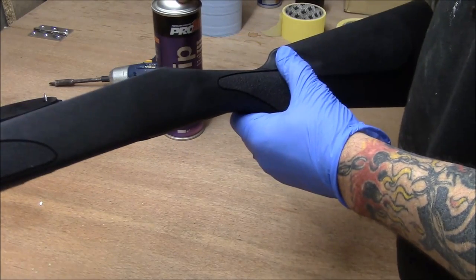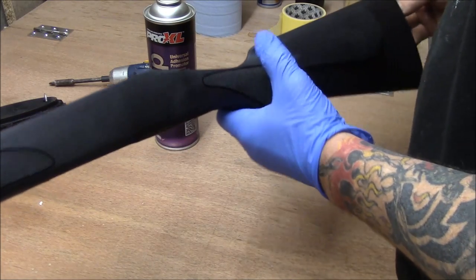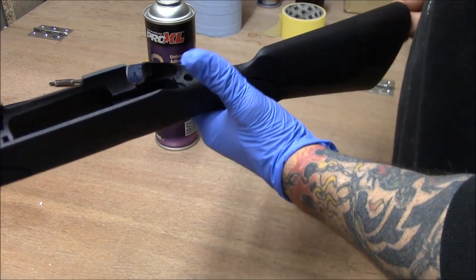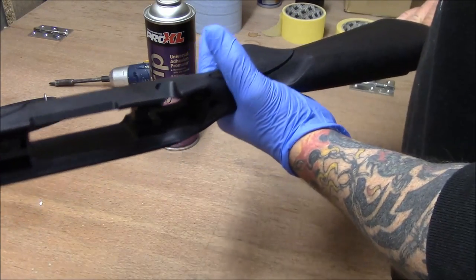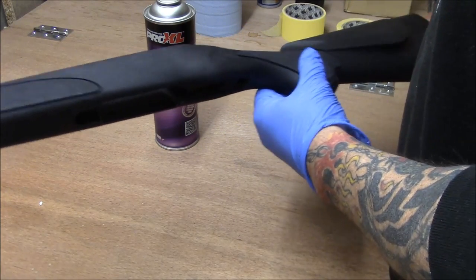I'm going to use an adhesion promoter, I'm going to use an aerosol primer, plastic primer, and I'm going to dip straight over a beige aerosol plastic primer. I've done it dozens of times, people say don't, I don't get it, it works. So I'll start with the masking and I'll get back to you as soon as it's masked.